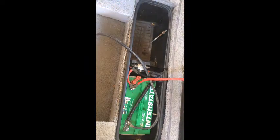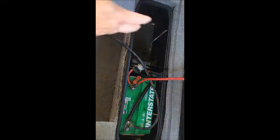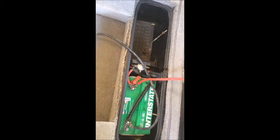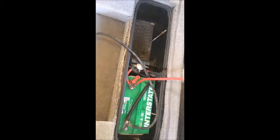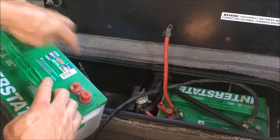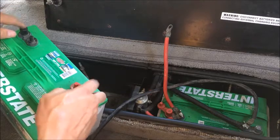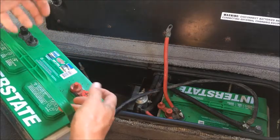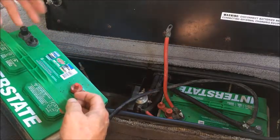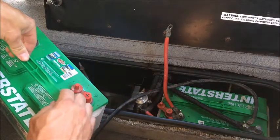The air holes are clear. I make sure that there's no rot there, nothing that's going to fail and allow my battery to actually fall through with vibrations and so forth. We want to make sure that the pan structure is still very much intact and able to support the weight. Here you can see that I've left the safety caps on the battery when I'm putting it in. Because we do have metal surrounding this, we don't want contact between these terminals and anything metal that can ground out or arc. It could actually cause the battery to explode and send acid up into you, which is not a whole lot of fun.